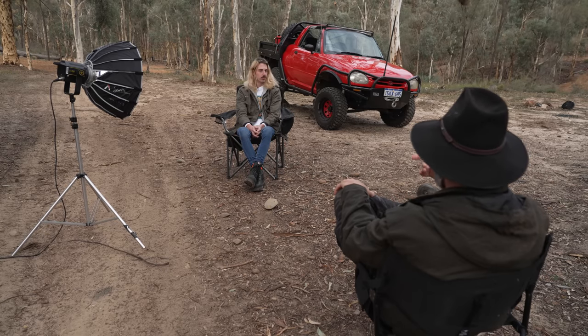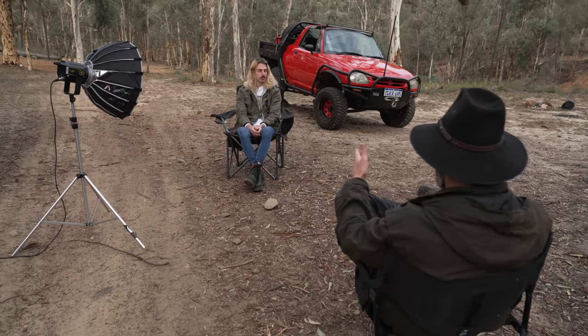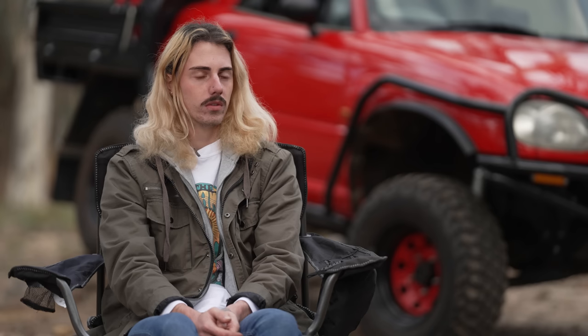That wheelbase is really good. So when you stretched it to suit the longer Vitara, that was so all the components were easier to put in? Yeah, exactly. That way I didn't have to worry about the tail shaft, really. And I stretched the front a little bit too just by changing the A-arms, and it's about a 99-inch wheelbase, so it's just a really good wheelbase that I wanted.